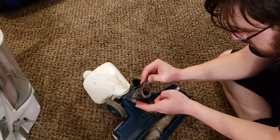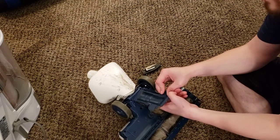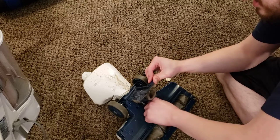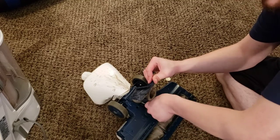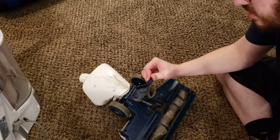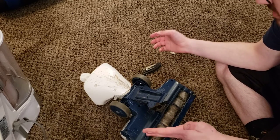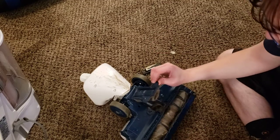We also want to check this hose for any splits. If this little hose right here has splits, then you're going to need to replace your power head. Shark does not provide the hose by itself. If you have a split in this lower hose, then you'll just need to replace the vacuum — that's just the way that Shark designed it. Parts are not available for these machines. Shark designs these machines to be disposable and does not make parts available unless you are willing to buy entire whole assemblies, like in this case the entire cleaner head. So if your brush roll is not spinning, or if you have any issues with this hose, housing, or if any of the plastic breaks, you just have to replace this entire cleaner head as one whole unit. If I can find links to replacing the cleaner heads, I will link them in the description. If Shark does not make them available anymore, then unfortunately you're pretty much at the mercy of Shark, and you're just going to have to figure out some sort of replacement elsewhere.